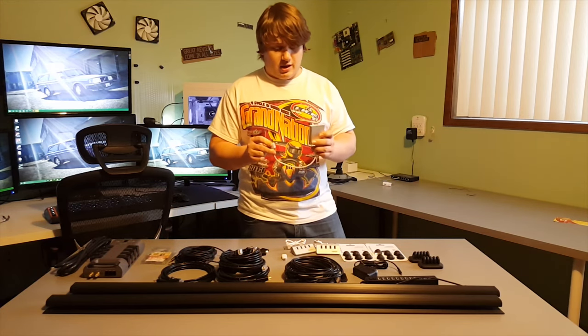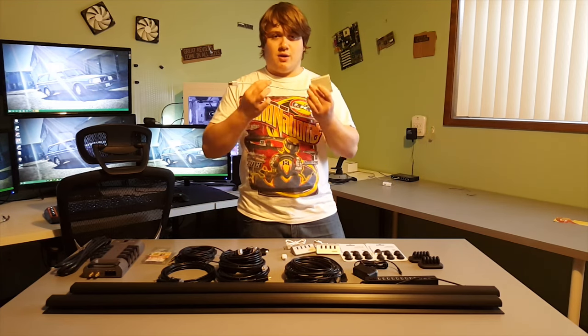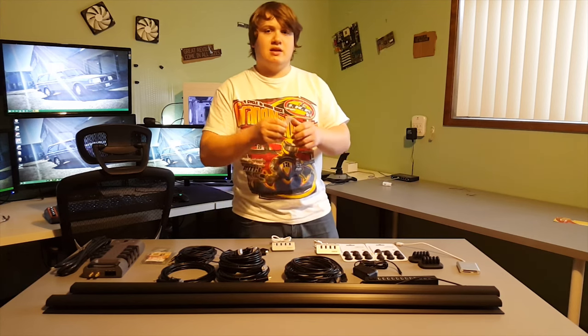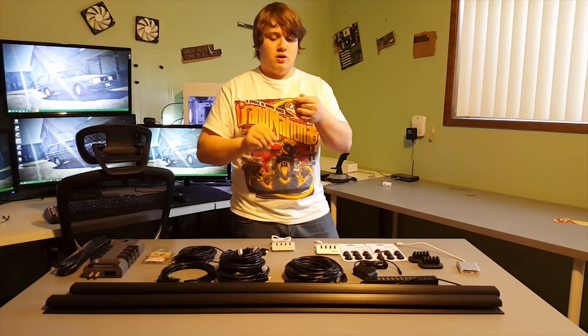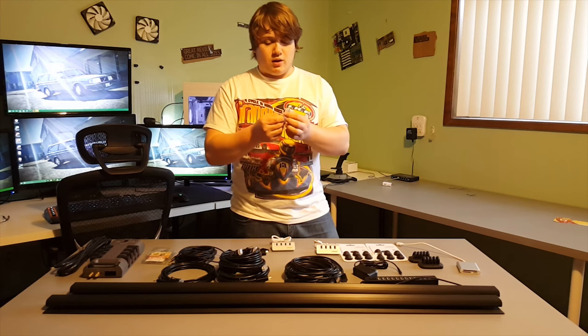USB 3.0, I have an internal 5 1/4 inch bay 2.0 one. Way too slow, annoys the crap out of me, so I decided to just grab a 3.0 one while I was at it. Not very expensive. Moving on to more hubs. Oh, one last thing, that Weme one comes with a USB Type-C to USB Type-A adapter, USB 3.0. So it wouldn't be running at 3.1 speeds, even though it's a Type-C connector.